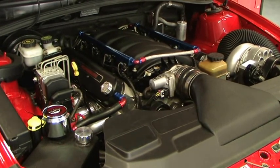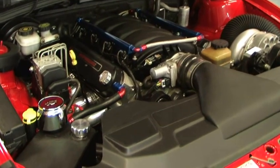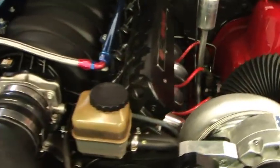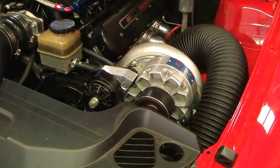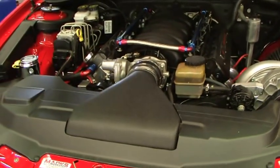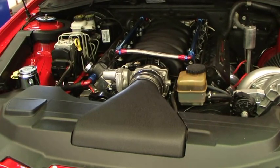It's put together as a 427 package. We've got a big exhaust system — two-inch headers, twin three-and-a-half-inch exhaust. We've got a V7 compressor on it running our 10-rib drive, and I've made a custom over-the-radiator intercooler for it. This is the first one where the intercooler actually disassembles so you can pull all the pieces fairly easily.